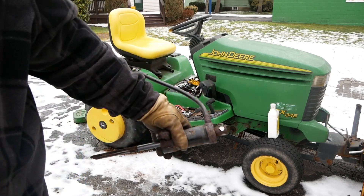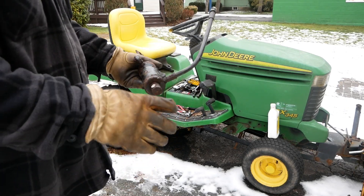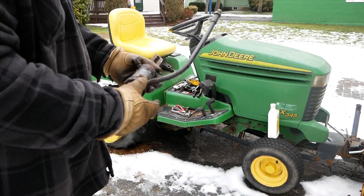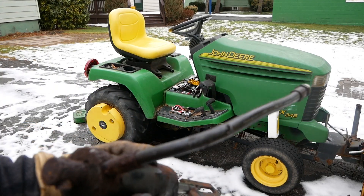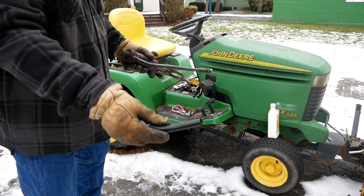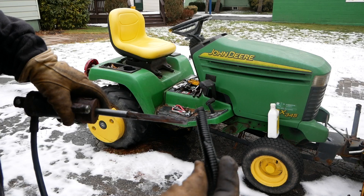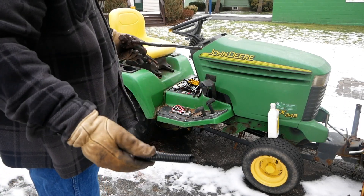As you can see, I already have it out. It was not hard to get it out, but it pissed me off because the clevis pin — I had to cut that out. I had to cut the shoulder bolt out that holds the end of the ram in place. And the line split. See where it ruptured right at the end here. It even had the wrap on there, but it's not through. I don't know how this one split.